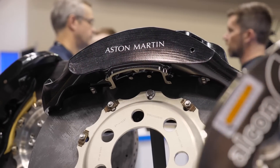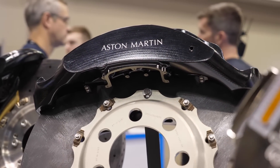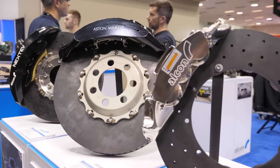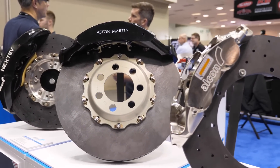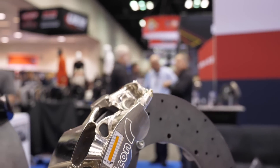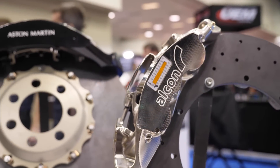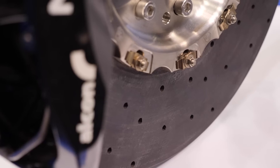In terms of the high-end production cars, we see carbon ceramic rotors — another take on that. Can you talk us through what a carbon ceramic rotor is? A carbon ceramic rotor was developed from carbon-carbon and it basically has added elements that improve the wear of the disc, which makes it much more suitable for the street. It performs very well when it's cold and through the temperature range.